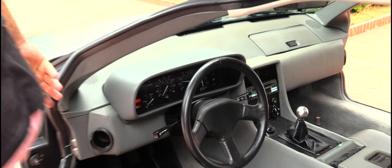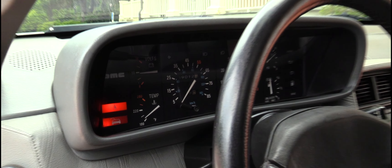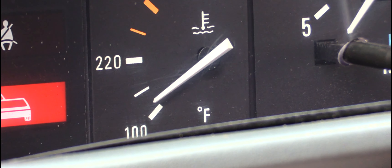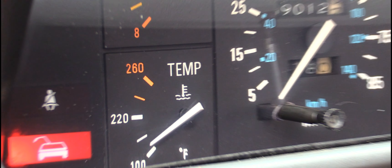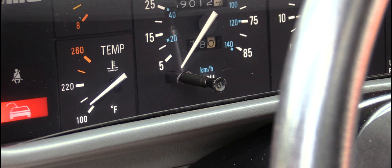Since that drive, all it's been doing is parked here. The temperature gauge has barely moved — it's sitting down there. It does work. Give it a little bit and it might warm back up and hit the next bar — probably sitting around 140 to 160 right now. This vehicle has the lower-amperage cooling fans that draw less amperage, about half of the ones that came in the vehicle originally.